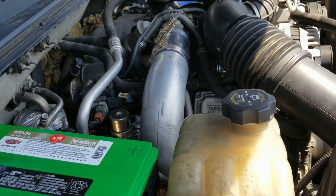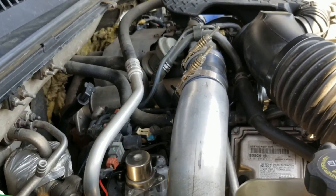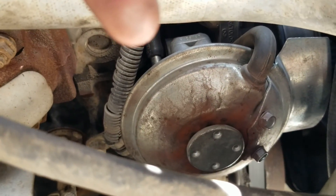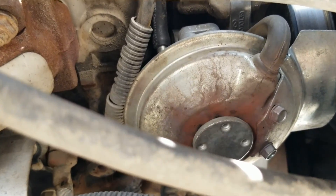If you're in California you're probably in the same situation I was, where you're not going to be able to pass smog unless you get that fixed. Basically, here under here we have our vacuum pump — that's that diaphragm there — and as you can see there's that little nipple up here that was part of the problem I had. The nipple has a hose that goes up from it.